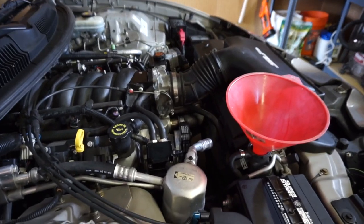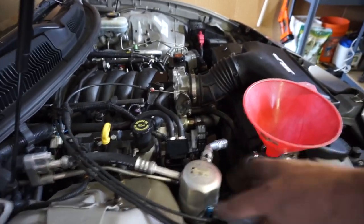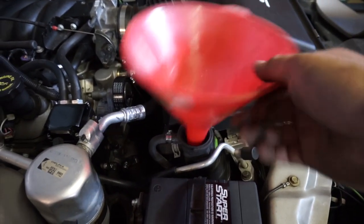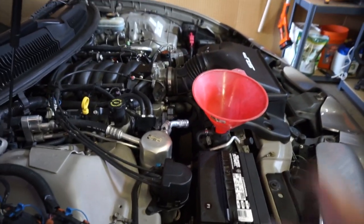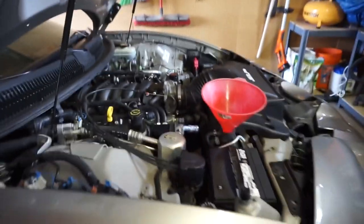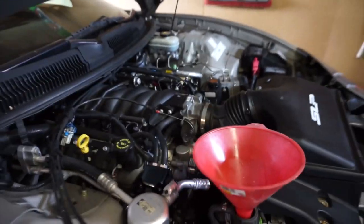Every time that the radiator thermostat starts to open, you're going to want to squeeze the upper and lower hoses a bunch of times to try and keep the air cycling through. And after a while, you should be able to see the coolant flowing through the radiator here, through where the cap is. So every time the thermostat opens, you probably see the level go down, and you want to add some more coolant at that point till it shuts and the system cycles and it opens again later. So pretty straightforward. It's just going to take a while, so I'm probably not going to film the whole thing. It's pretty obnoxious, being a loud car, and otherwise, we're about ready to start it, so here we go.